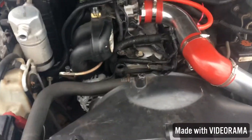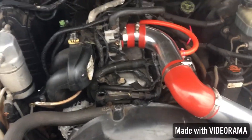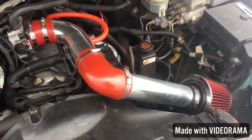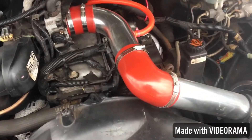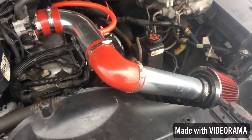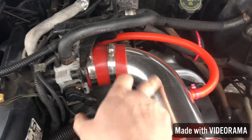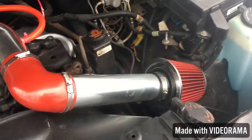Update on what's going on with the S10: I got some spark plugs and the belt for the AC delete — the version that didn't have AC. I also got the cheapest air intake available on eBay, about $38. Turns out it was a good thing I got rid of the AC because the intake doesn't fit with the AC compressor. So if you want to buy an intake off eBay, the cheapest one does not fit with the AC compressor. You might be able to use some aluminum angle to move it over, but it doesn't just bolt on.